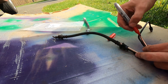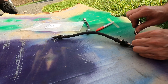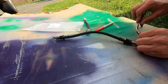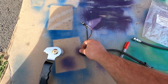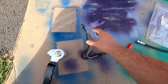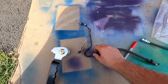As I go along making my bends I can use a marker to help me position where the bends should be. This stuff is usually pretty easy to work with, so in some cases I won't even really need the tubing bender to maneuver it where I want. This isn't a perfect replication of the factory bend, but it should be close enough. This piece is just a little bit longer than the factory one, so as I install it I'll need to work at it and change the bends a little, but this should get me close as an initial attempt.